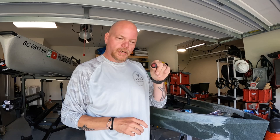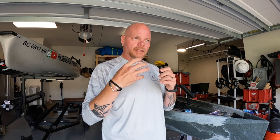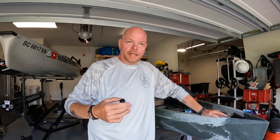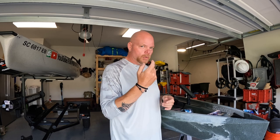Since I have an electrical background, I'm just adding my own little low-voltage switch. This switch I had laying around from putting lights on my truck — it can actually light up too, but I don't need it lit up. I'm going to put the switch next to my seat so I'll know if the lights are on or off. My navigational lights only need to be on for maybe an hour, hour and a half max. I thought about wiring it straight to the battery, but there's no reason to have them on all day — eventually they'll burn out. So I'm adding a switch, keeping it simple: just one switch to operate these lights.